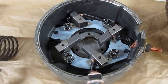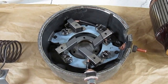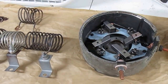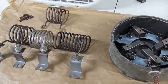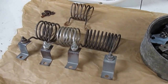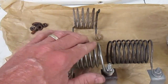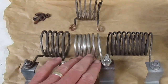I had one other problem I failed to mention. We were at Disney World when this happened — camping at Fort Wilderness campground — and the wire that burned off the motor stud, I tried to temporarily repair it just to get the golf cart back on the trailer. I had no intentions of running it anymore, but when I rewired it the wire was kind of short and it actually went right across what they call a second speed resistor and was touching the resistor. I knew that was happening, and I know these resistors get hot in normal operation.